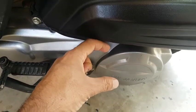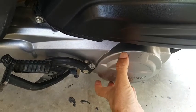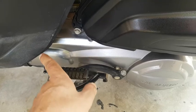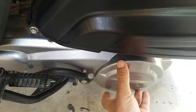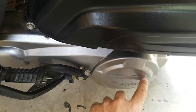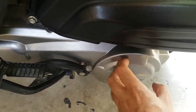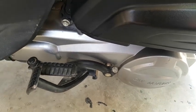When the diameter of the pulley is smaller, the drive belt will shift outwards, so the diameter of the pulley increases. At slow speed the load on the engine is reduced. As the speed of the bike increases, the diameter of that pulley starts to increase and the drive belt starts to shift towards the center, so the diameter of this pulley becomes smaller — allowing the speed of the bike to increase.